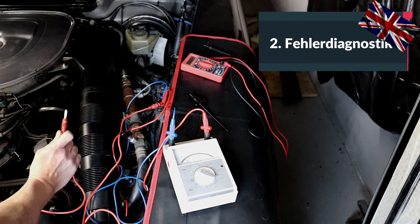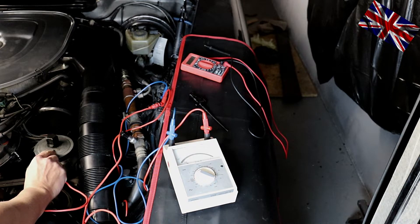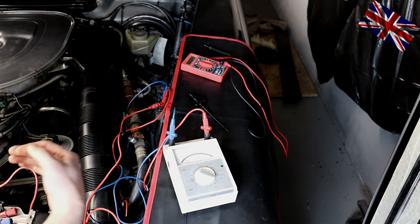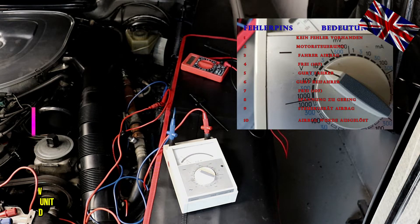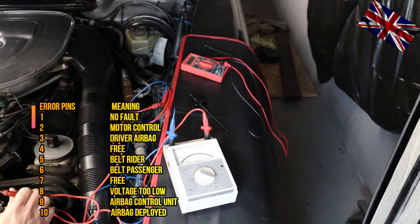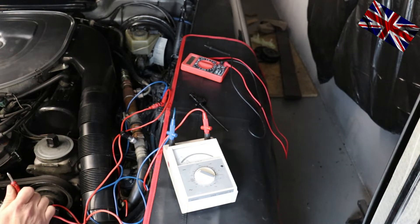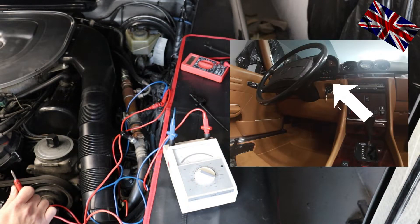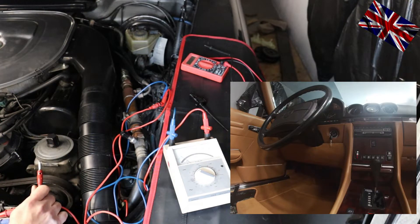You can now look it up at your chart. It tells you number 5, which is the seatbelt driver's side. If you do not have such an analog multimeter at hand, there is another simple way of telling what is wrong and which component is faulty. Just get a prolongation to extend the length of the third cable so it is long enough to reach into the cockpit, so you can put the tip somewhere there to ground. You simply count the flashes of the lights in your control panel — here you count all the pins.